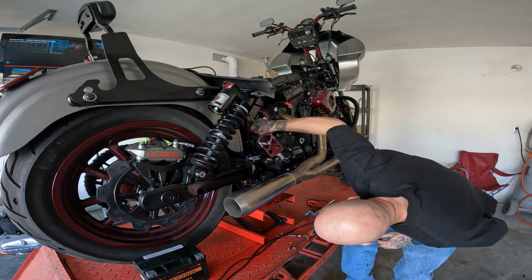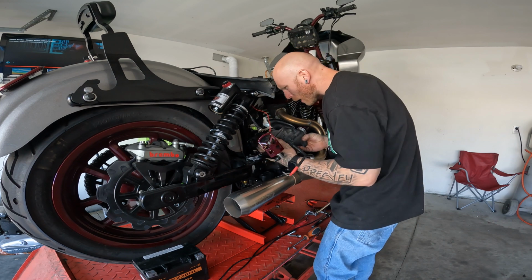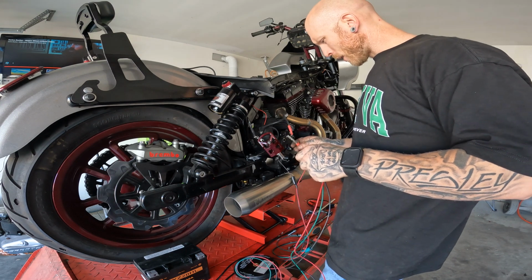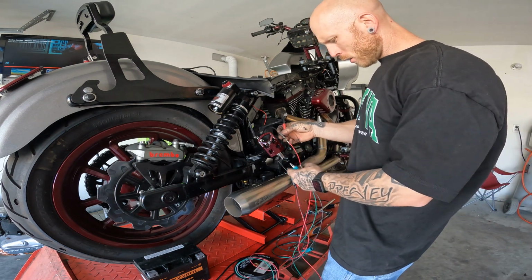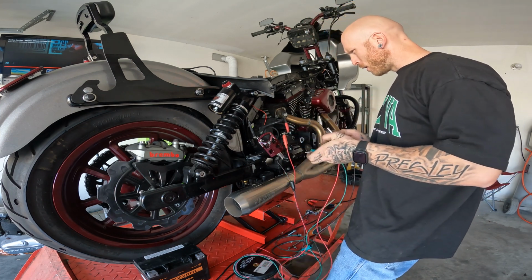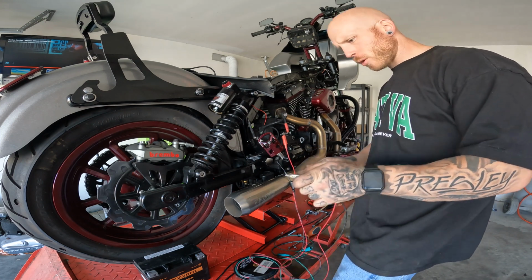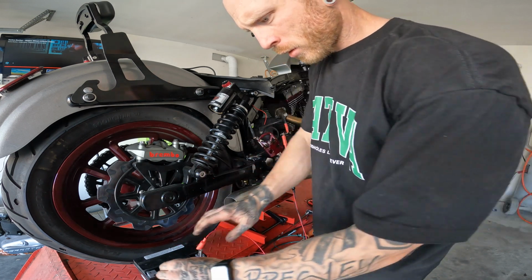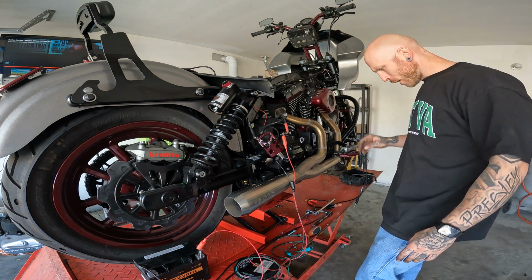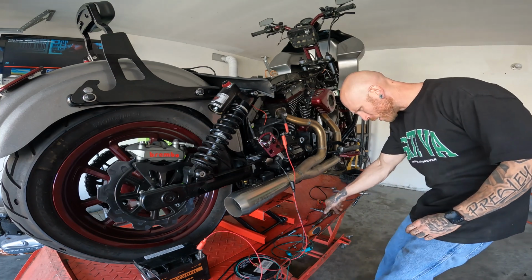What's that? Something fell. Oh, that could be a pinch, could not be. Maybe, maybe not. So I'm gonna connect all these alligator clips straight to the battery, since our battery is obviously not going to be hooked up here. And I want to check and see if we're getting the same ground readings off of our power probe, the same hot. Because there was one that didn't make sense to me when it was hooked up, but you would plug it in and it checked out fine. I was reading a ground where I didn't think we would be getting a ground.